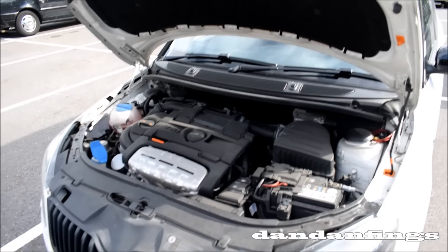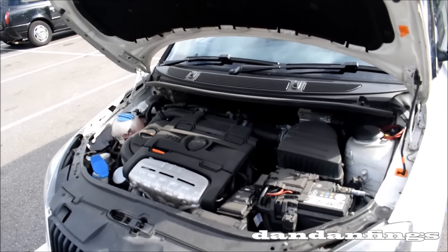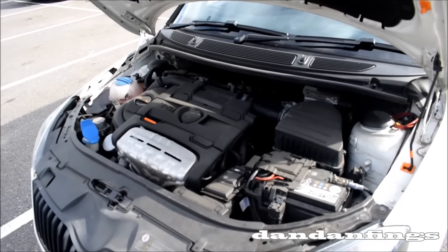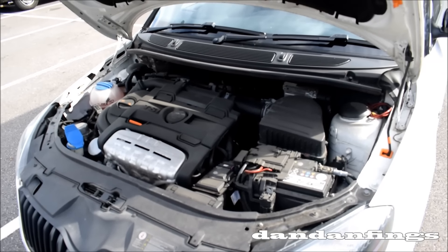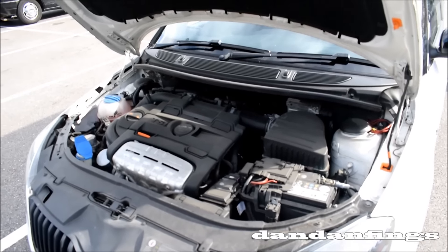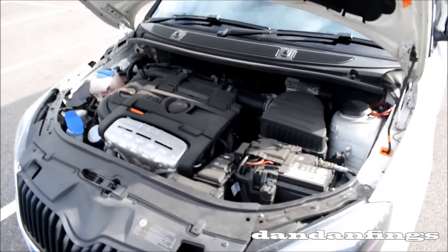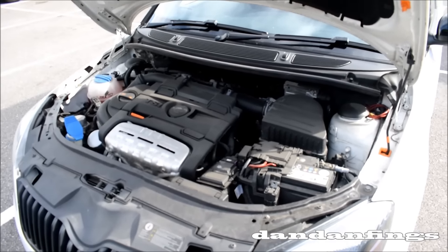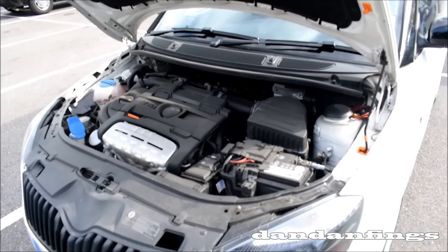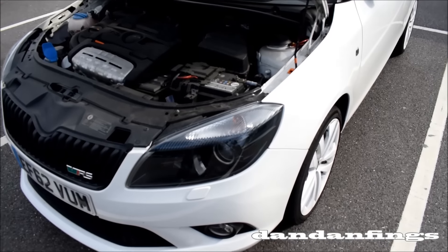And I accidentally discovered something. I noticed that the car became much quicker — from idle all the way up to about two and a half thousand RPM where it crosses over with the turbo. I learned that the reason for that is because the soundproofing material causes the supercharger to get too hot, and as such, loses a bit of power. Now that I've taken it off, the supercharger is cooler, colder air is denser and it makes more power. It is a complete little animal off idle. I've never known a car so sharp. You have to be really careful how you press the throttle, because it will just light up the wheels in the first three gears. It's hilarious.